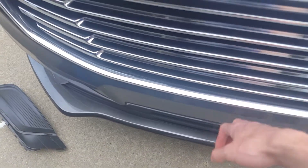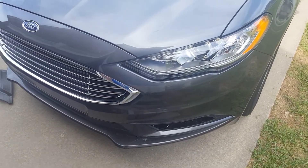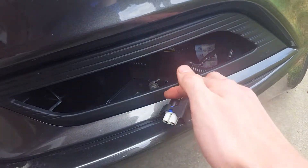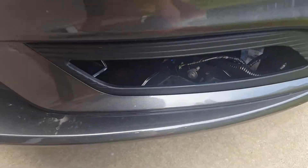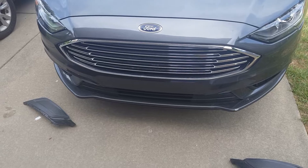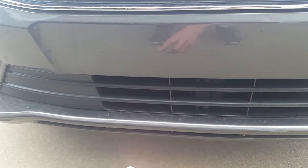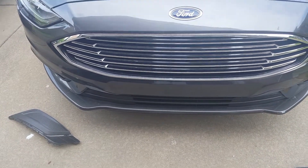After you get the bumper off, since this car was not equipped with fog lights, I had to get a whole new wiring harness — the one with the fog light connector. Yours may not come pre-wired. I went on eBay; this is a 2017 vehicle and I got one from a 2016. The only difference was how the active grille shutter connector plugged in from the bottom — the connector was smaller on mine, and the one that came with the wiring harness was bigger, so I just cut and spliced the matching wires.